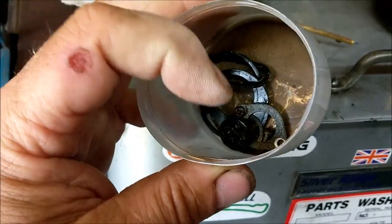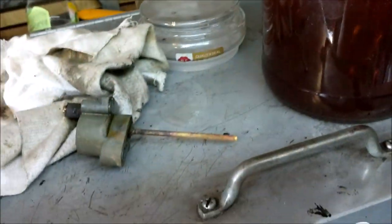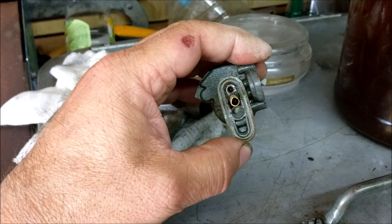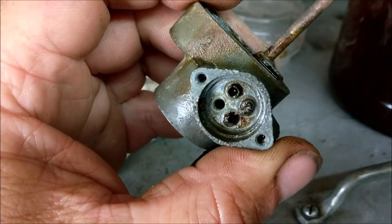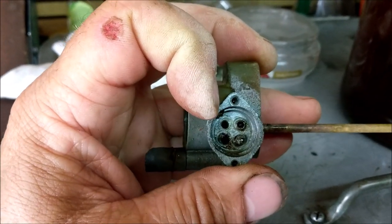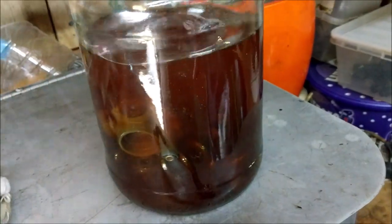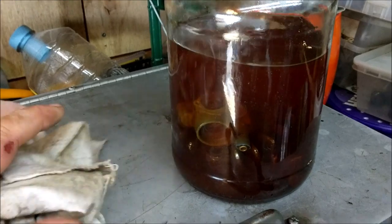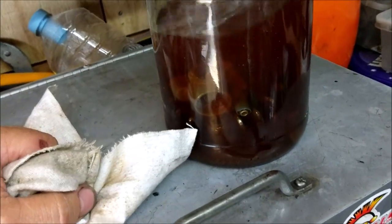Here is the original fuel petcock. I've removed the seal - there's a few bits and pieces in there. That little disc valve was completely blocked with that black treacly varnishy stuff that was inside the fuel tank. You can see down that pipe - it's blocked. One hole's free, the rest are blocked. So it's going into the mixture of doom - I'll submerge that completely, the lid goes on. That's going to build up a little bit of pressure because of vapors, so I'm just going to give it a swirl and see if the thinners can get rid of that sticky crap.